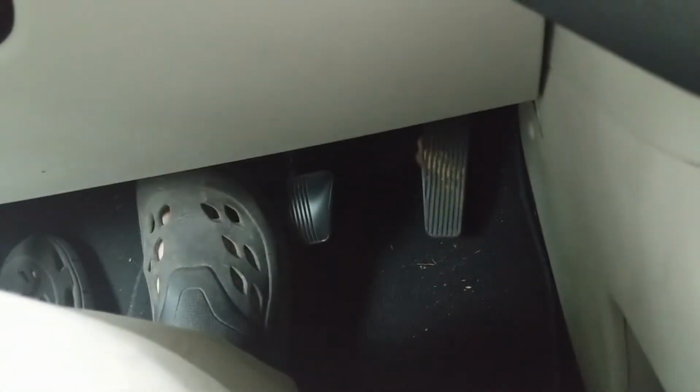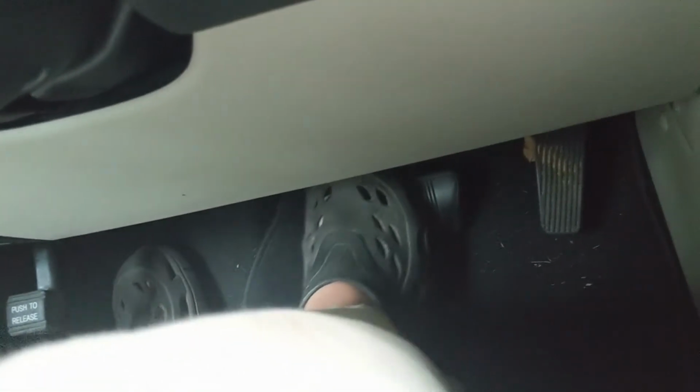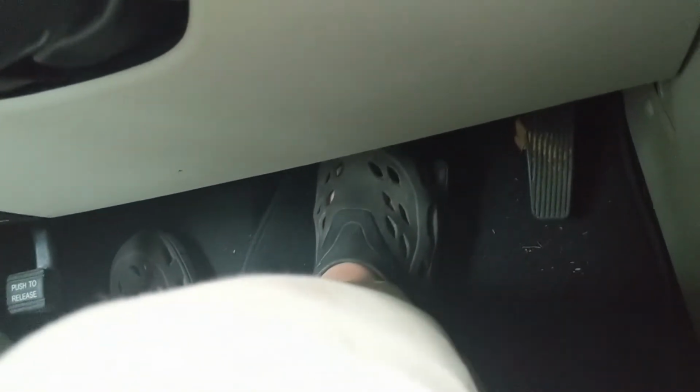Okay. And go down here. And at first it's going to go all the way to the floor. That's okay. We got our lid back on our master cylinder. We're just pumping back up that brake piston until it's tight. Shouldn't take long. Got new shoes and a new rotor. All right. I think we're ready for a nice test drive.